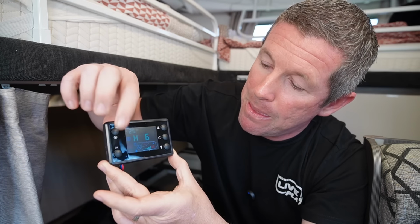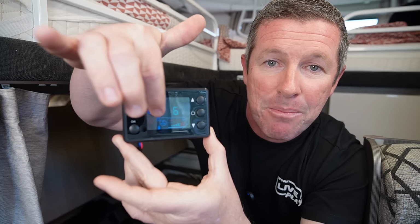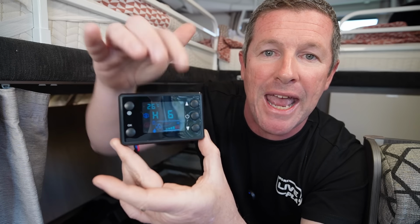So you make it around 3, I find, is a very happy medium. Depending on where you are, how cold it is, you might wind it down to 2 or bring it up to like 4 or 5. But as you can see here, the bar goes up and then it hits the red, and that is what will actually trigger the diesel heater and the igniter and everything inside to get going and go through its normal function. So we'll let it start up.